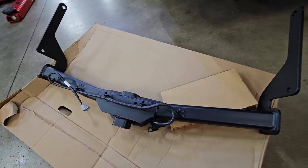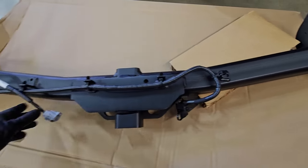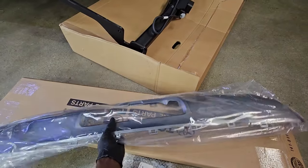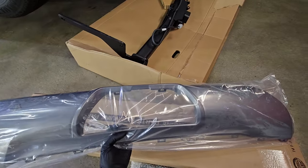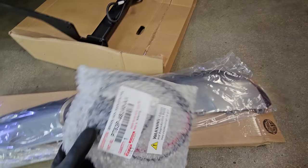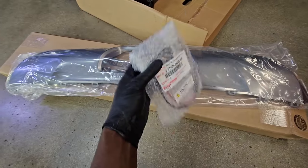The main component we got here is the tow hitch. It already comes with the wire harness included — easy plug and play, you don't have to run a harness all the way up to the front with a fuse block. You got a lower bumper cover fascia right here already pre-cut, so you don't have to measure out anything. You've got your kick sensor and I'm going to talk a little more on what that does in a bit.